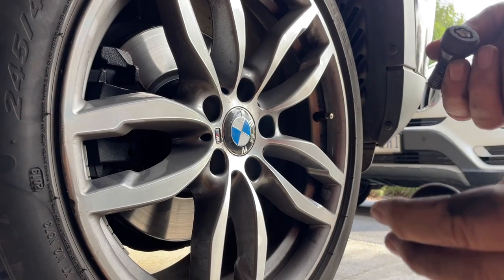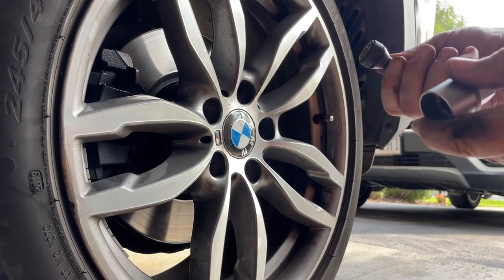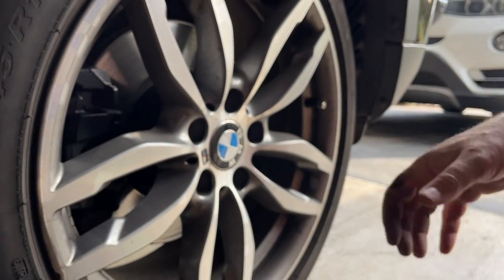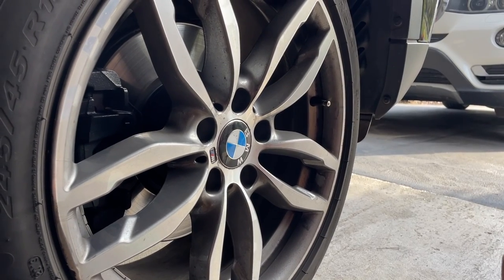You will strip off your lock nut particularly, but you can also damage your other nuts — far less likely with the non-lock nuts, but with the lock nuts there's a big chance you will damage them. So there's today's tip: do not use your pry bar to get these nuts too tight, and yes, it does matter.